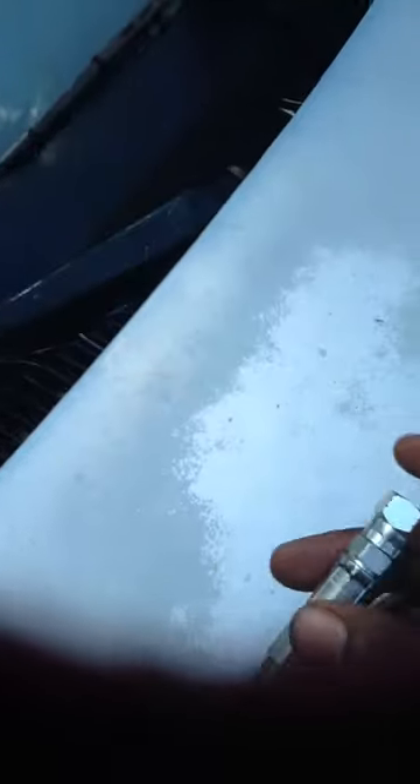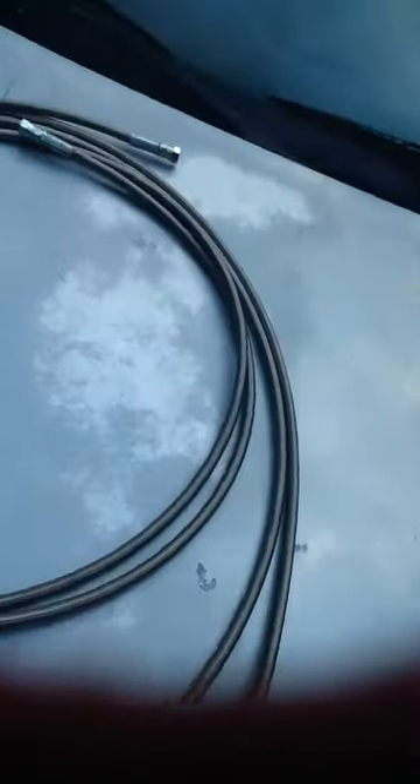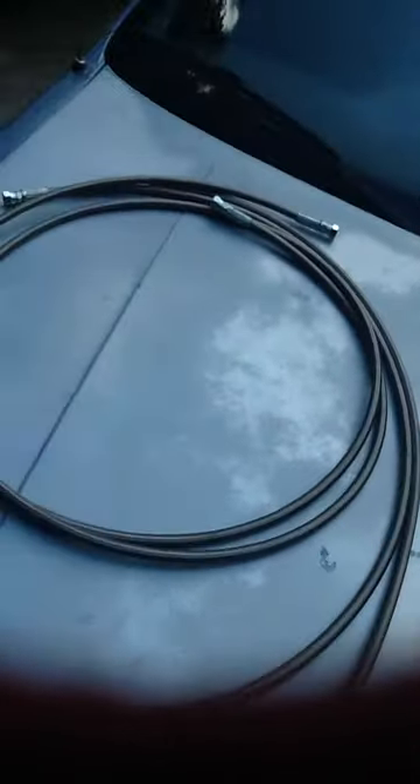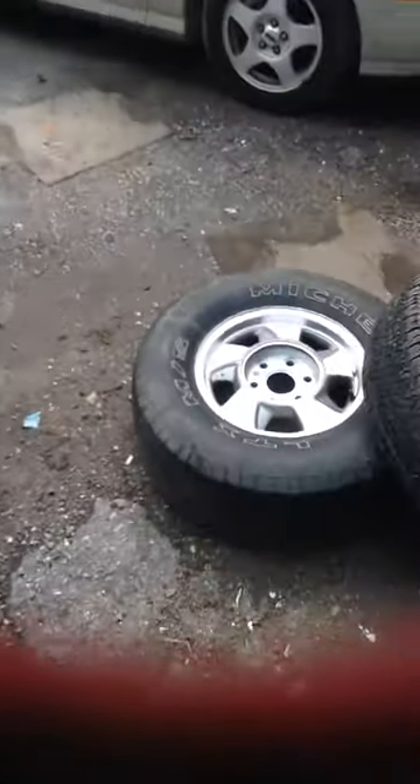Pretty nice stuff here. It's got the swivel ends. That's going to be all my fuel lines. Got a quick connect. I got two different sections — I measured out what I needed: two six-foot sections, about 12 feet of line basically, each way, pressure and return. I went ahead and I'm going to run both a pressure and a return line instead of the Corvette regulator.